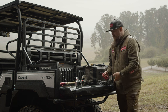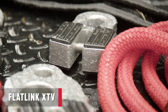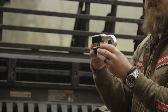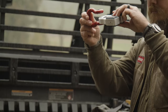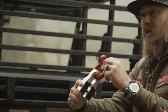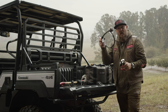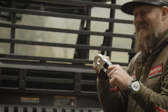Moving past the ProLink XTV, we have our FlatLink XTV. Just like the ProLink XTV, it has a titanium double shear pin. It pulls in and lays flush against the fairlead surface. Each shackle mount has integrated rubber pads to prevent metal-to-metal connection. With the FlatLink XTV, not only can you use the pin end of the shackle to interface through here, you can actually take the body of the shackle and pass that through for a single shackle connection, making it more versatile to attach to bumper connections or other rigging pieces.